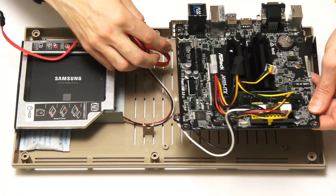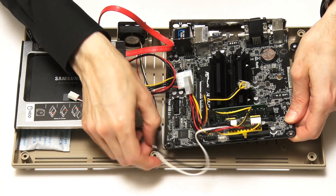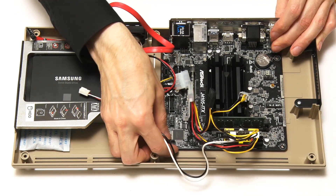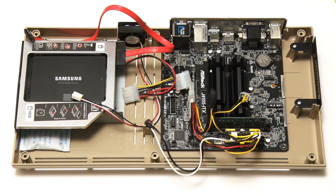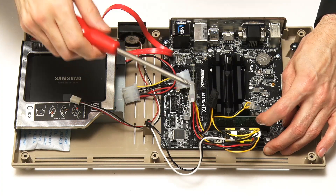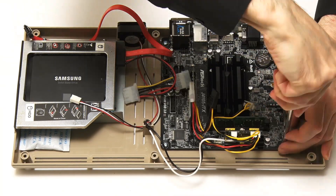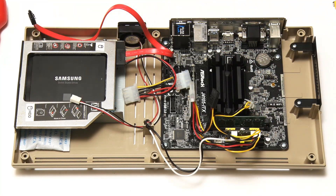We can now take the motherboard itself. Maybe I should have fitted the I/O shield second — there's never a perfect way to do anything, is there? Is it going to line up and get in the back? Yes, that's gone in pretty well. We'll now just take the motherboard screws and put them in loosely first, because we need to press the motherboard up against the I/O shield at the back, keep it nice and tight. Then tighten them properly. The motherboard is now nicely secured into the case.